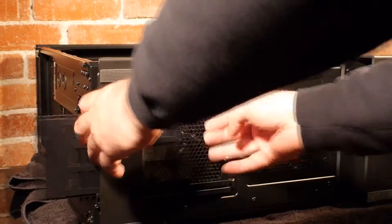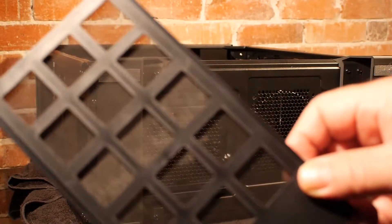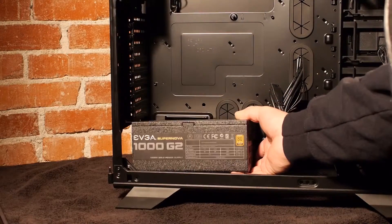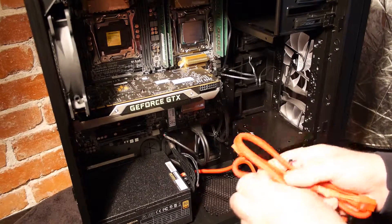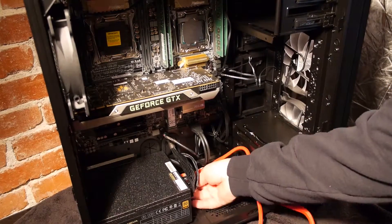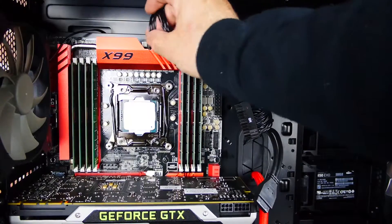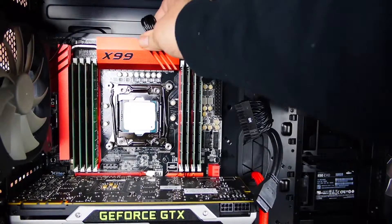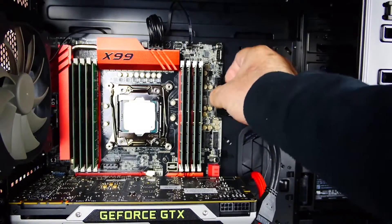Anyway, enough unboxing — let's install this. The first thing you should do is make sure you have a good filter for the air coming into the power supply. The Corsair 760T case I'm using has a good filter. Then it's pretty straightforward: you place the power supply in the box, tighten down the screws, plug in a few cables. I pull them back into the wiring closet in the back of the case, then back into the interior close to where they'll be used. Then you just plug them in — each cable is marked on both ends, so it's pretty easy.